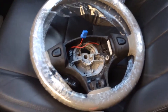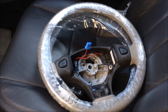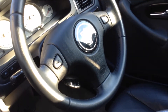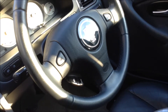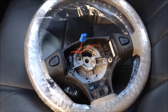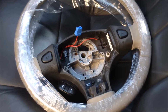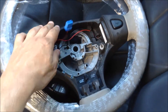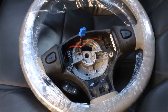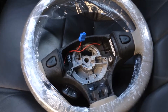You've got the airbag module in the middle which needs removing — you don't get that with a new steering wheel, you have to use the original one. You can see it sits in between the two horn buttons, marked up with 'airbag' and the Rover badge. The new steering wheel also has horn, volume up/down, and station up/down steering control wires, and the airbag wire comes through there as well, all connecting to the movable ring.